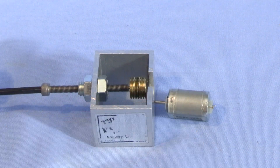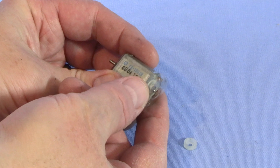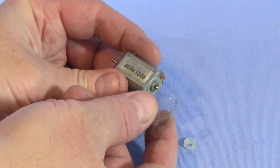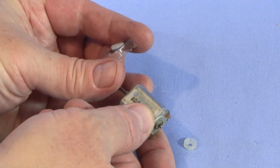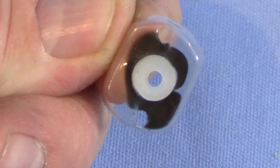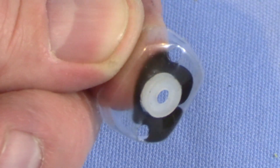And it's off. The other important thing about this motor are these little clear plastic caps on either end — these are insulation, and without them the locomotive mechanism will probably short out. So it's important to keep these and transfer them to the new motor.